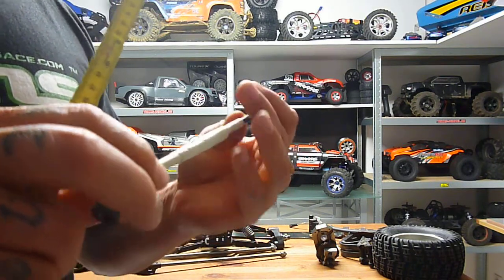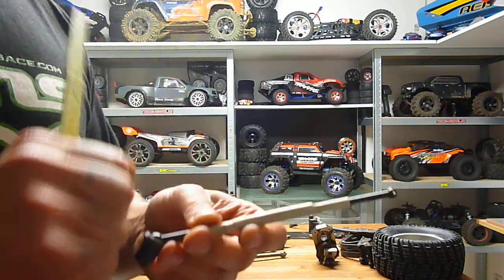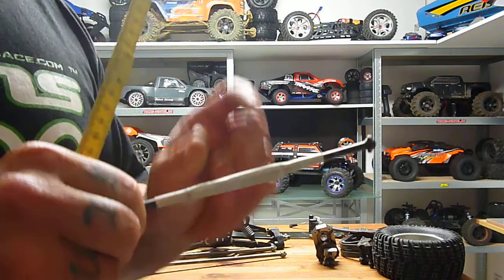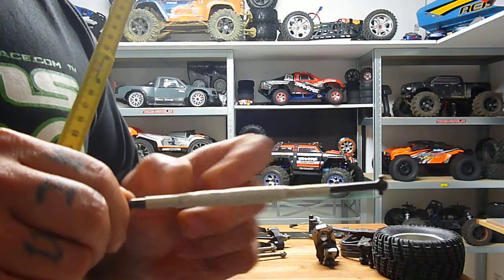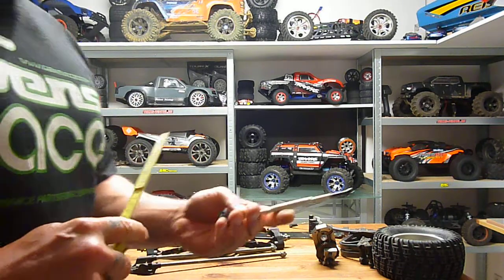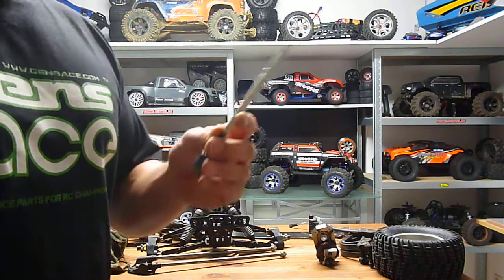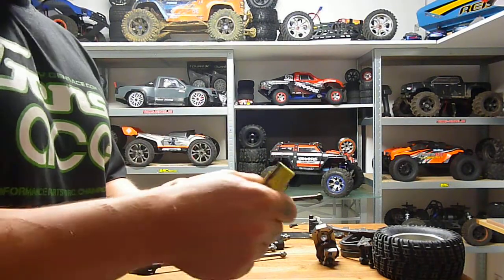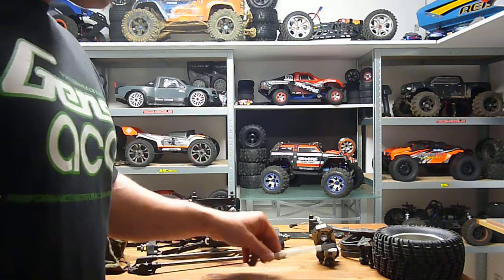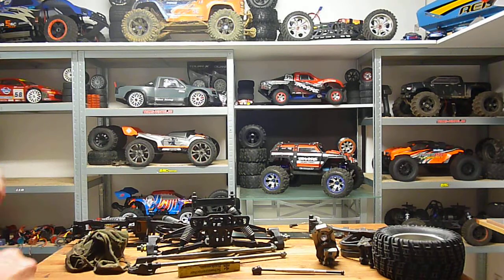I think personally if you go to the next garage or metal workshop with the original CVD and a piece of tube, they will cut it in two and solder it together with the tube on it — it's the right dimension. I made this in one minute: cut it in two, put the tube on, set the right length, and solder it.